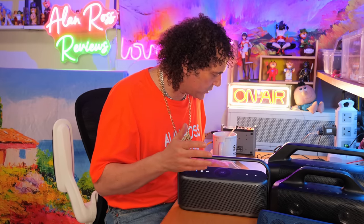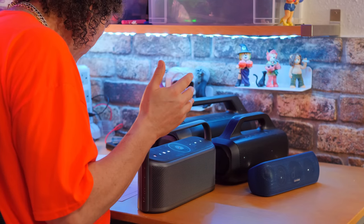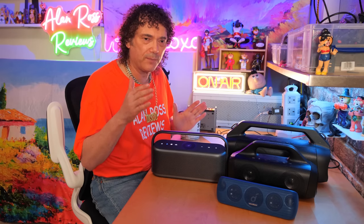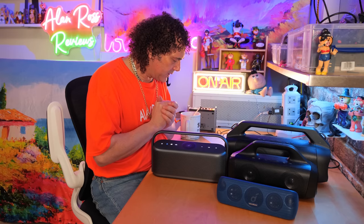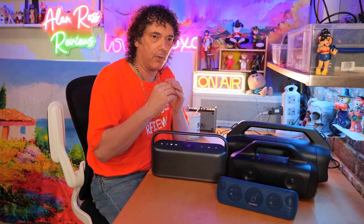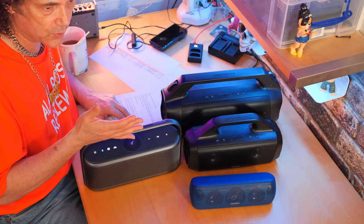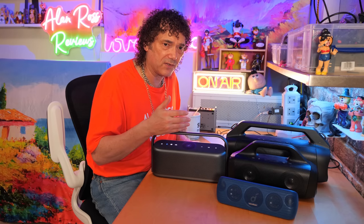And then you've got the wireless. High-res audio in terms of wireless has got to be able to decode 24 bits, 96 kilohertz into the sound that you're actually hearing. So it's about the ability to decode that. And in strict terms, it's about anything that goes above and beyond CD quality. CD quality is 16-bit, 44.1 kilohertz. LDAC can top out at 990 kilobits per second, but it's adaptive. So you probably have to be quite close to the source to get that, or it will drop back to 660, 330, I think it is. But for it to be high res, it needs to be at 990.